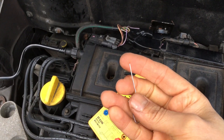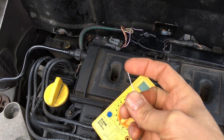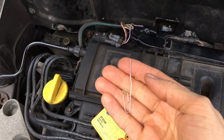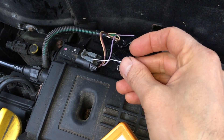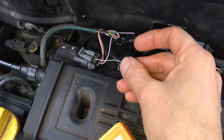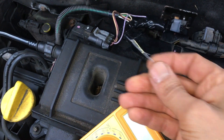What we've got here is a homemade T-pin — basically a paper clip that we've opened up and used a bit of sandpaper to take any sharp edges off the end. There are two reasons for that: it makes it easier to use, and it makes it less likely we're going to damage anything. We're going to use this to back-probe the three wire connections on the back of the MAP sensor and see if we're happy with those readings.